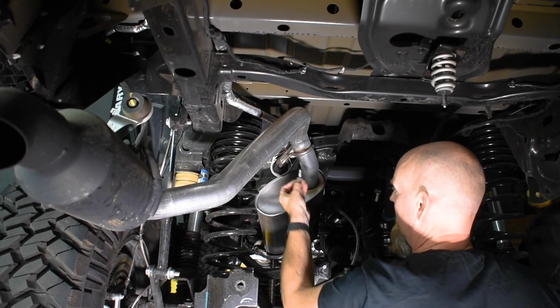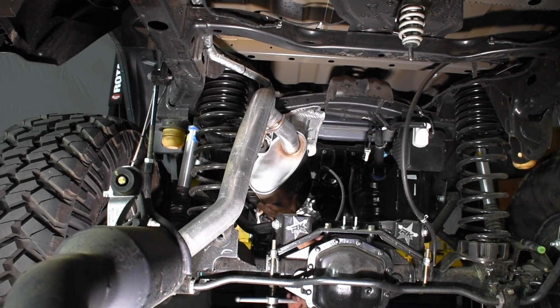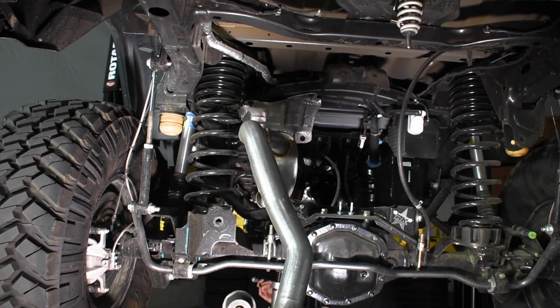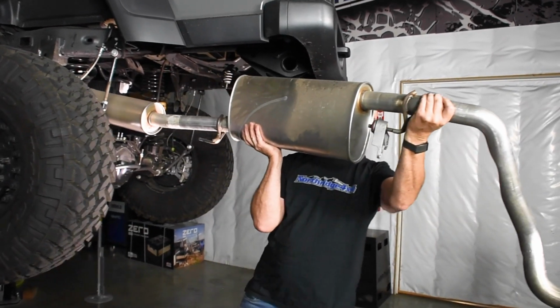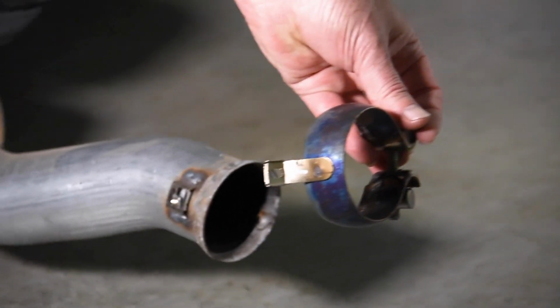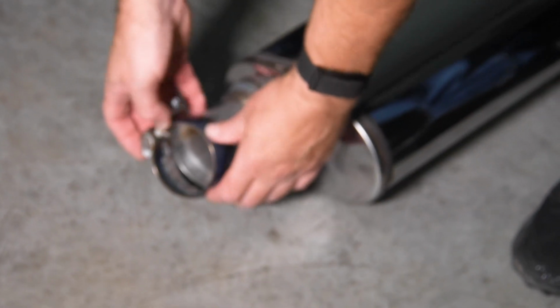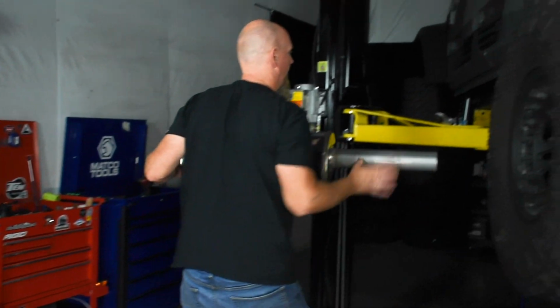Once the exhaust is loose, it's easiest to slide it out through the back with the suspension drooped all the way out. To make it even easier, cut the exhaust in half and remove it in 2 pieces. Use a small screwdriver to pop the retaining clip up and remove the factory ball clamp from the old exhaust, and then install it onto the Magnaflow ball flange.